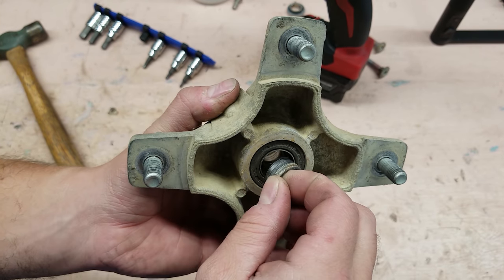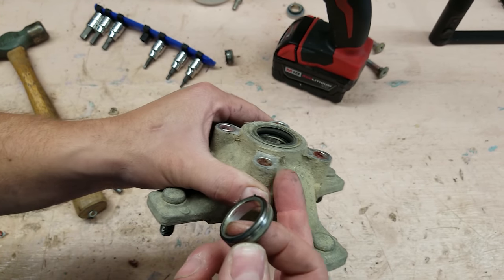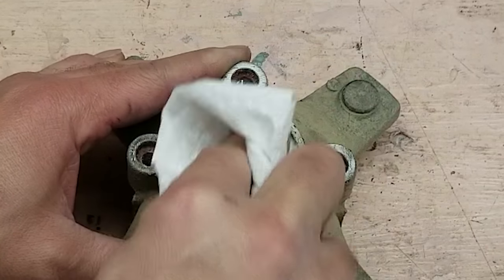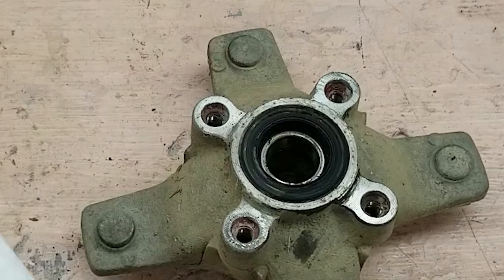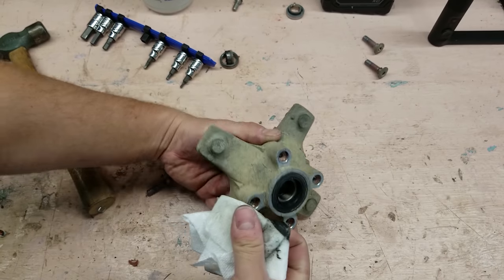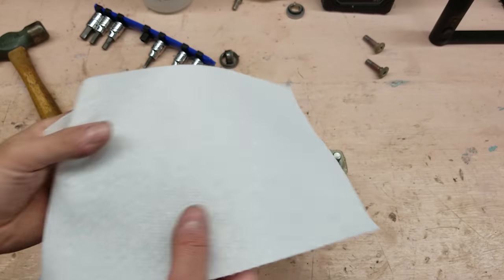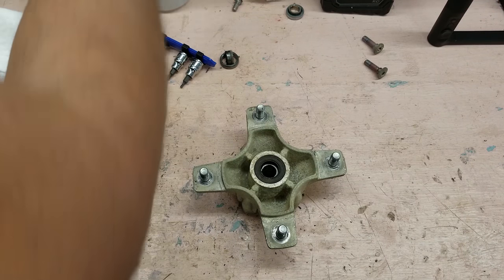The first thing I want to do is pull out these little spacers, clean those off, and put new grease in there because we're going to reuse these bearings and seals. To clean the seal off it's going to take a little bit of lacquer thinner - lacquer thinner cuts grease like crazy. Just gotta be careful, you can't use this stuff on painted surfaces because it'll eat through paint. But for cleaning grease off seals it really just cuts it. This stuff is like thick, old, crusty grease with dirt in it. This is not going to be a show quad, but if I'm going to take it apart I might as well clean it up.